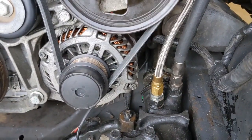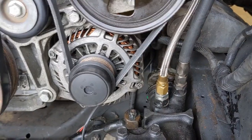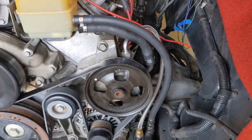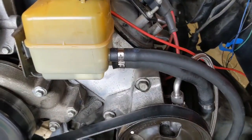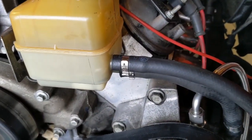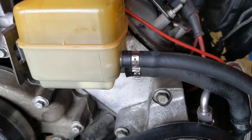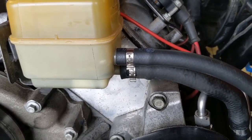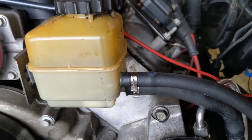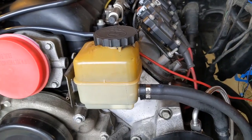You use the adapters with a regular hose that has AN fittings. On this one I used some new-style clamps — they're PEX-style. I only know PEX from plumbing, but they make a set you can use in automotive applications that are smaller. I got that on Amazon, so just look for pinch-style clamps.